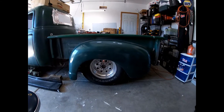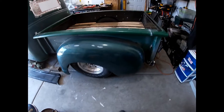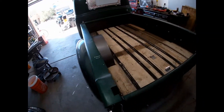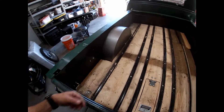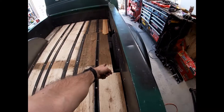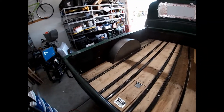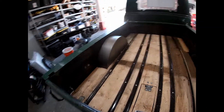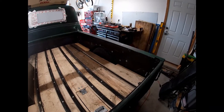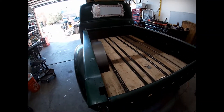There's a 31-inch tall tire in there and it fills up that wheel well nicely. Half started putting a wheel tub in there — gonna have a lot of room. It's actually about another two inches into the inside of the frame rail, so the tire could easily be three or four inches wider. It's a 31 by 10.5 right now, so 31 by 12s would fit in there no problem.